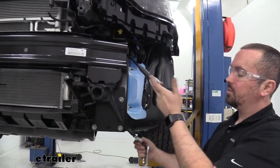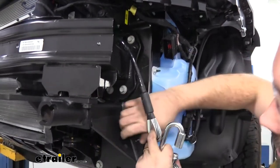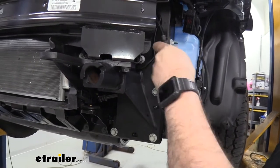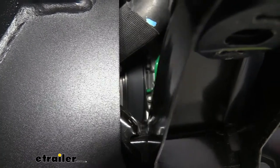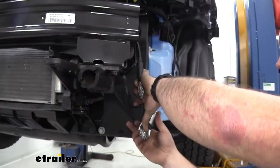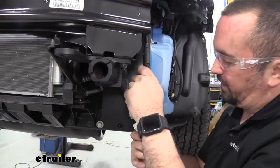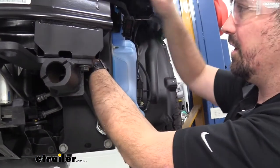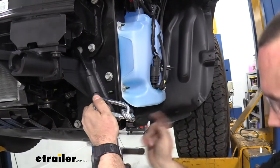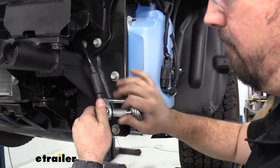Run the safety cables through the frame — the goal is to connect to the back side of the frame and also attach to the base plate, so if hardware fails the cable holds to the frame. Route carefully: on the passenger side there's a belt nearby, so make sure no cable slack rides against it while driving. On the driver's side it's more open — loop both safety cables through the base plate opening, route them behind the core support, and tighten them down once both are looped in. Double-check the cable routing to ensure it's not pressing against anything that moves.